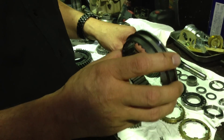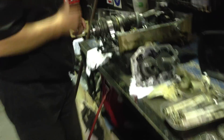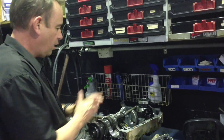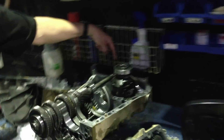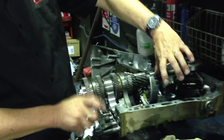This is the part that slides inside the gearbox on the fork mechanism. In an old five-speed transmission and the upgraded six-speed version — what we call the five-speed case — they're a clamshell design, so you pull it apart like this. This is where the engine is and this is where the tail shaft is. In the middle, the part connected to the clutch driven plate comes through the driven gears, and all that assembly sits in here with the parts sliding onto it in constant mesh. You can see the other broken matching gear for the part we've already dismantled, and the drive is transferred to the output side of the box.